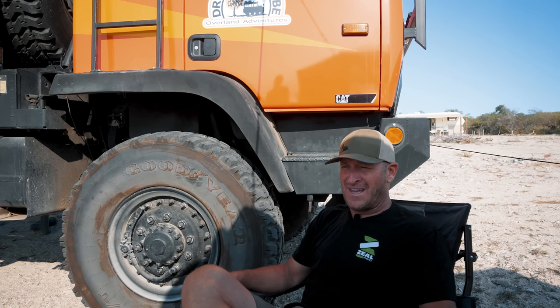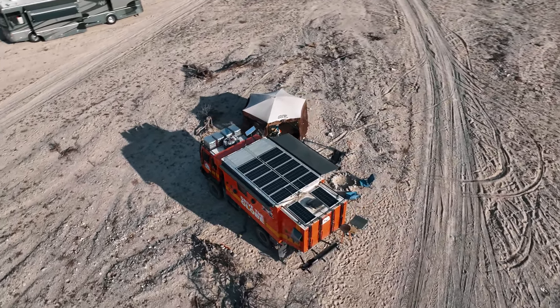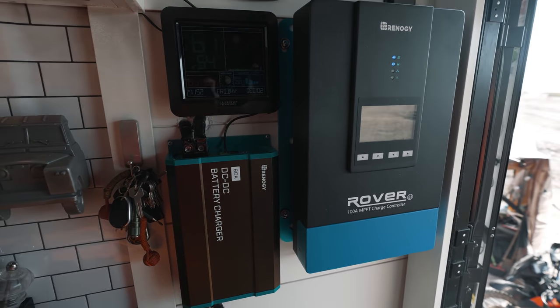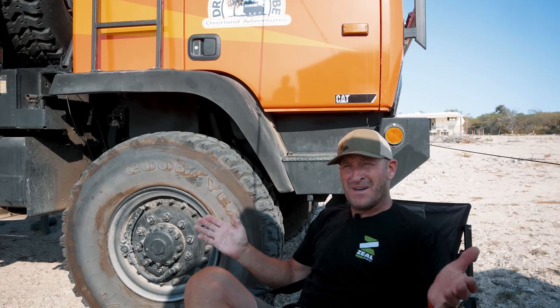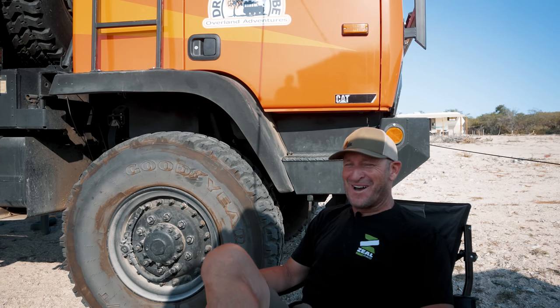On top of the fact that it'll run on just about anything, it's much easier for me to work on — I do a vast majority of the work myself. One of the nice things about this truck is that I can stay off grid for pretty much an indefinite period of time. I'm limited by water — I have about an 85-gallon freshwater tank. As far as energy and solar, I can live indefinitely. I was probably unplugged for a total of eight months last year and never really ran out of solar energy. I've got 1,200 watts of panels on the roof and 900 amp hours of lithium battery supply. I can plug into shore power. As far as water, I can suck water from a stream bed, from a well, from a domestic hookup — I've got multiple filtration systems, including an LED UV light filtration system for drinking water. In theory, I could suck it out of an African swamp and still survive.